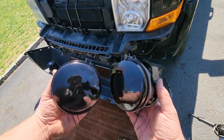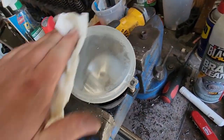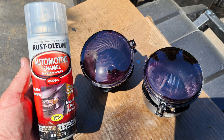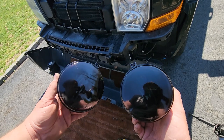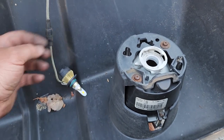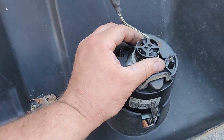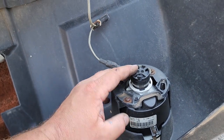Check out my new foggies. What I ended up doing was sanding them down with 400 grit, then cleaned them up with a little bit of brake clean. Then I painted them with some VHT Nightshade — I found a little bit left over from a former project — and then I hit it with some clear coat for a little extra protection. You can see some imperfections still on the rim over here, but all in all it's much better than that crusty old one. Once your fog light lenses are secured, go ahead and pop in your fog light bulbs — these are Bosla four-way bulbs with the white, yellow, and flasher mix.